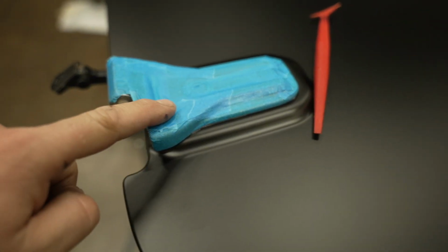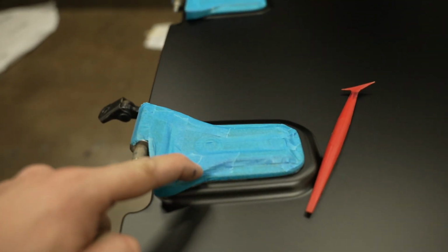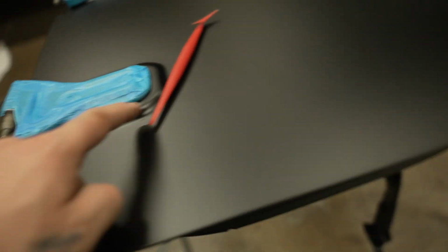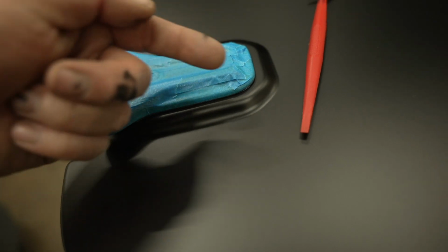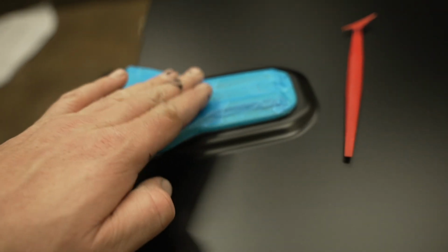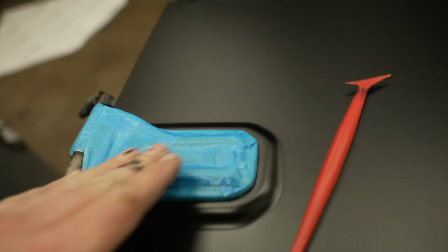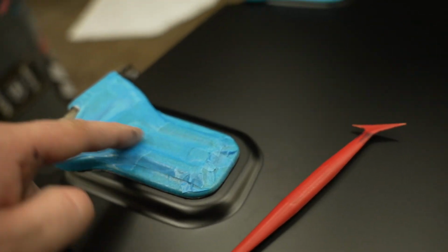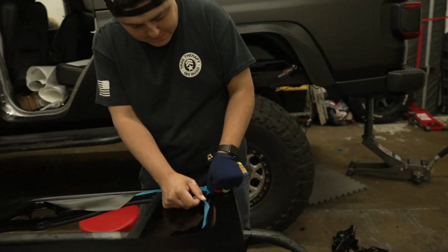I was wondering because I was like, you're wrapping this, and I'm gonna paint that. Why are you masking that? And that's because when he's going around this, he needs to be able to rest the blade without cutting into the paint. This is a barrier. So this is basically a sacrificial layer to protect the paint. It's a protector, like a shield. Even though I'm painting them, those cut marks would show. And eventually they'll rust over time if the paint's cut down to the metal.